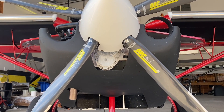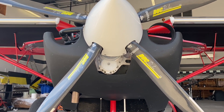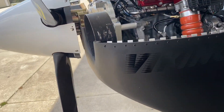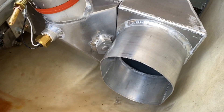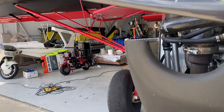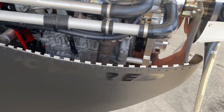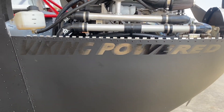It would also be nice to add a little drain hole underneath the gearbox in case you want to drain the gearbox oil without taking the cowling off. This inlet is used to feed an intercooler — the duct is out right now, but there's going to be a duct right here that goes right into the intercooler, which sits down inside here. The other side is just open, and that's to bring a lot of air in and cool the area where the hot parts for the turbocharger and the exhaust pipes are.